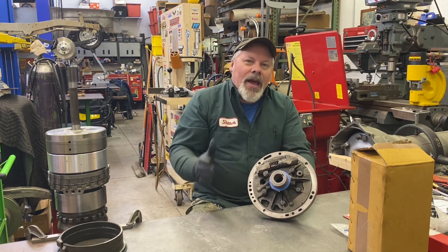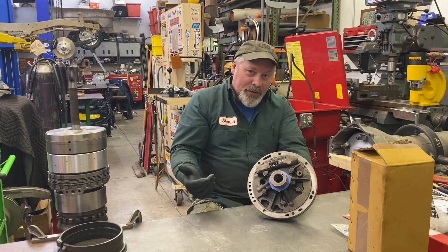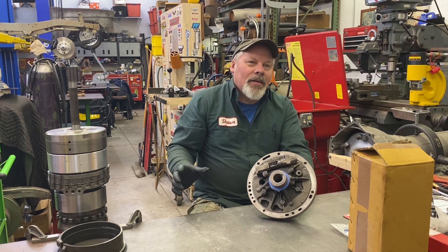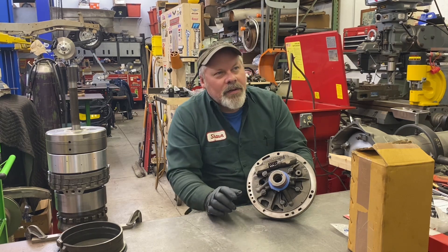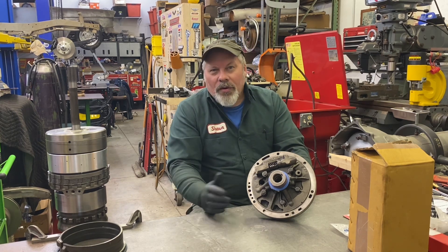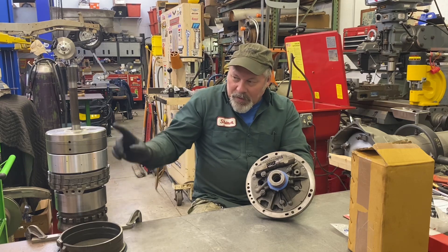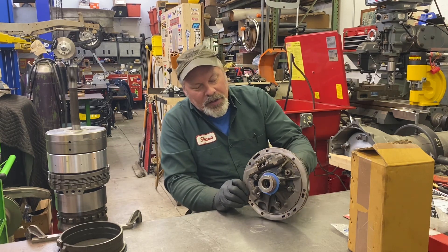The current transmission that I have built, I built it for the 72 Nova Twin Turbo Nova. I kept it when I sold the car and now it's going in the Race 55 Chevy. That transmission — I bought actually the inside of a complete transmission that had a roller bearing in every position except on the center support, I believe. It was sold as a low drag unit, all ETI, used but in perfect shape. So in this new transmission, I'll have a roller forward hub and the roller bearing in the case, and the rest will be just thrust washers. It'll be a good comparison.